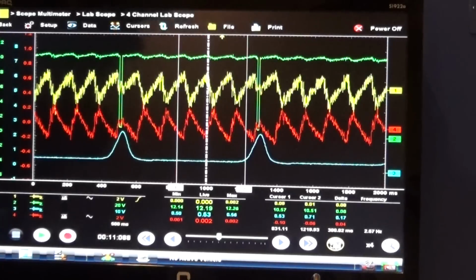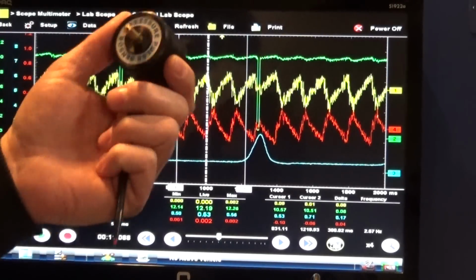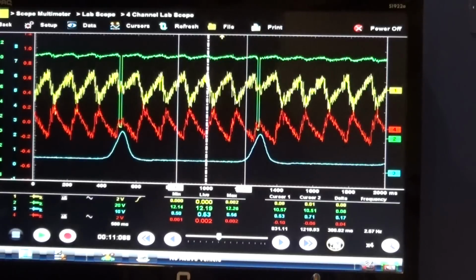If you have a healthy engine, each piston is gonna suck the same amount of air and push the mixture of air and fuel. In this instance only air, because the fuel is disabled. So the same amount of air that's sucked into the cylinder is gonna be pushed out into the exhaust. So if you have a healthy engine, we're gonna have the same pulsations from each cylinder. So let me put this up. I'll show you the setting, and then we'll do this test.